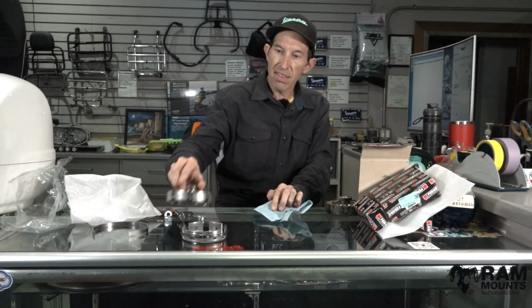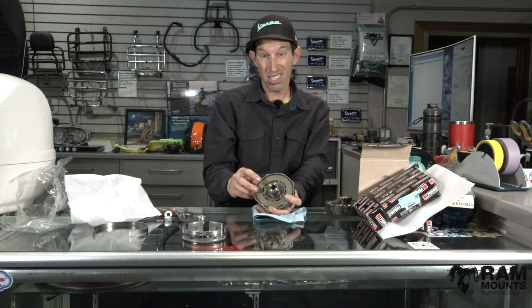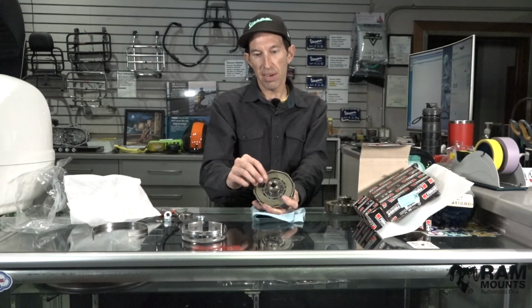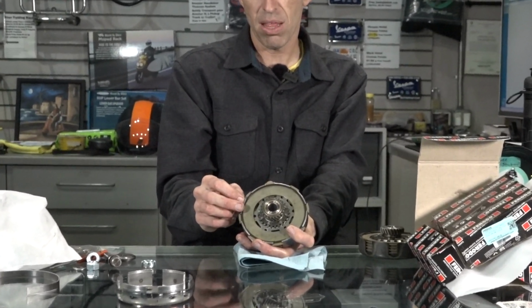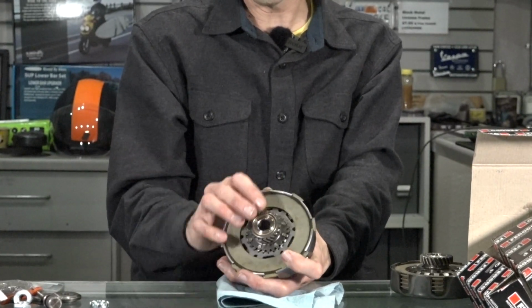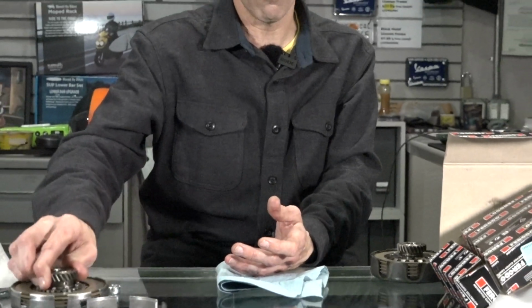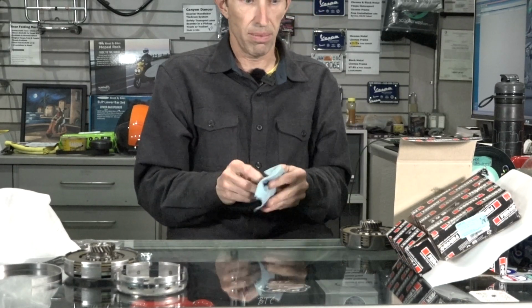The installed height of the clutch, these are all engineered for the oil pump. They got the little bit smaller gear. The older clutches, I think this height is a little bit different. And there's different spacer washer thicknesses, whether it's an oil pump drive gear or the older ones just have a thin thrust washer and they typically have a little bit thicker gear. You gotta get that installed height correct when you install the clutch, especially when you're retrofitting a newer clutch into an older scooter that doesn't have oil injection.